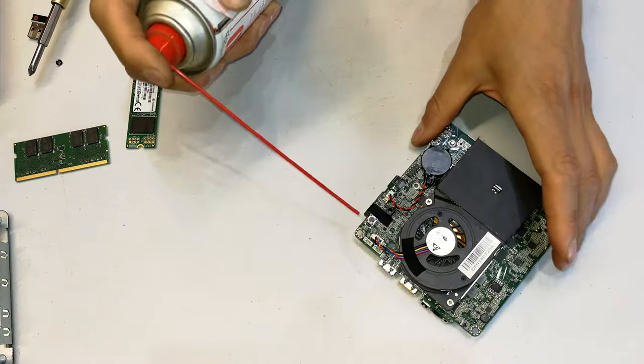You don't have to worry if you spill the contact cleaner around here — it's not a problem. Now I'm going to test it with the switch cleaned. I'll plug it in — at this point if you feel more comfortable putting it in the casing you're welcome to, but I just want to see if it was the switch. I plug it in, hold the edges, press the button, and look at that — the fan immediately spins! That was the problem. I'm going to unplug it quickly.